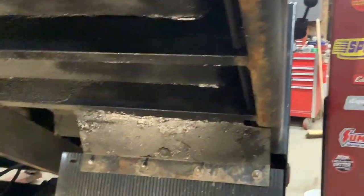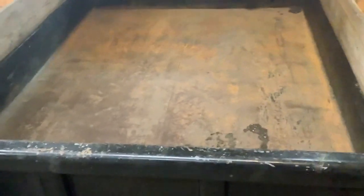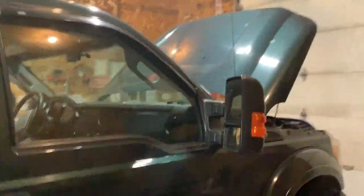I'll do the same thing on this side — I'll wire brush it, rust kill it, then primer it and paint it. If I get time, I'd like to paint the bottom of that box with a roller to keep it from rusting through — a good coat of paint will shed a lot of salt. I came up three inches of stone guard all the way around and that'll keep it from getting those chips that start rusting it out.